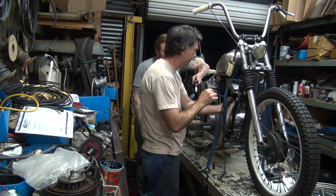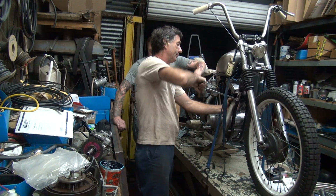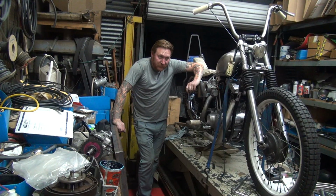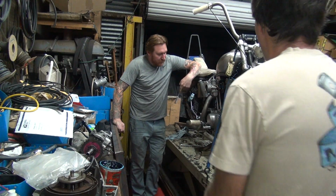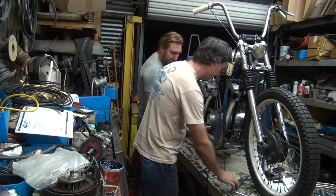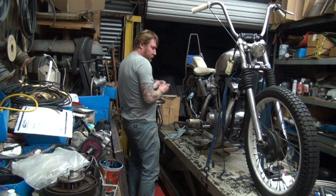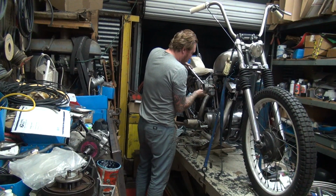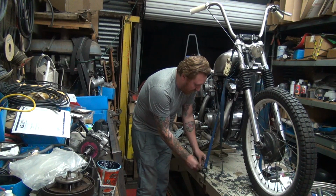Okay, that thread seems like it's wrong. I don't know. Chances are you probably got the wrong thread. Give me that bolt. You use the old dual clamp, that's probably wrong anyway. Coarse thread. See, that's why your old one's broken. Wrong hardware. Could get that half inch. Oh, jeez, he broke it. He broke it. Keep these lock washers, get rid of these things.